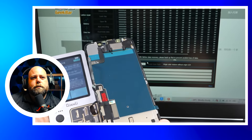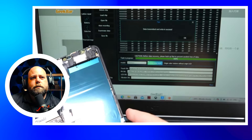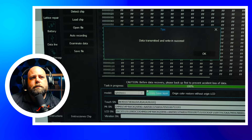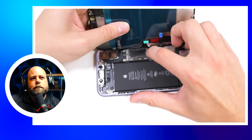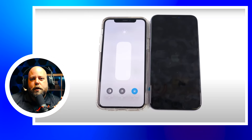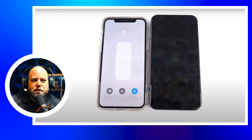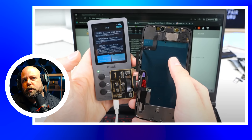Just do it. Open it up, unscrew, remove the screen. Now we can take our programmer, plug it into the computer. The program immediately recognizes that it is connected. We'll click the button, connect the screen to the programmer, and hit repair. The program is now transferring the data onto the programmer, which will then program the new screen. We got a message that says 'Write In Succeed,' so let's test it out.